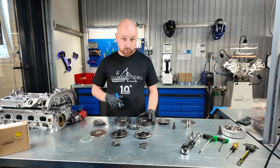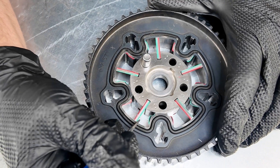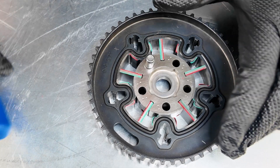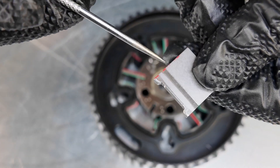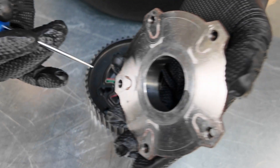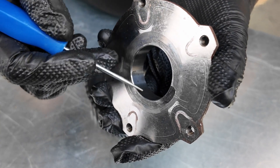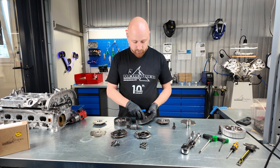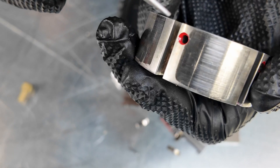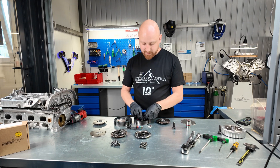Another very significant malfunction — also causing rattling but typically during operation or when descending from high revs — is the excessive play in the blades. These blades over time develop quite a bit of sideways play. When we pull out such a blade, you can clearly see how much wear occurs over time due to constant movement, friction, and the natural aging process of the material. In this particular situation, there's really nothing you can do about it. Another very crucial factor that affects the tightness of the entire system is the wear of the rear plate — it's caused by friction and primarily lubrication issues. The greater the wear, the larger the leaks become over time. Another component that gets damaged is the outer diameters of these valve mechanisms. It's very easy to see precisely where the friction and wear occurred. Very significant oil leaks also occur here, which directly influence the functioning of the entire system.